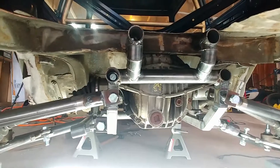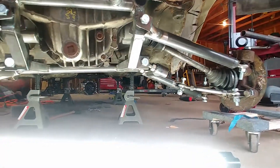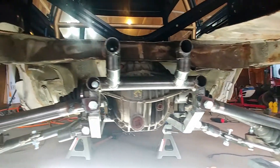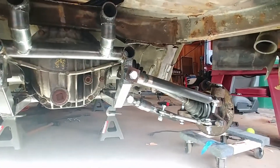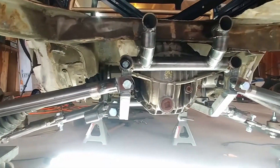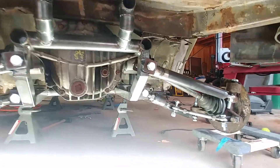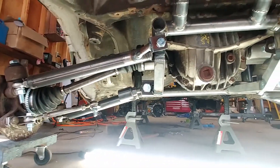I can actually get almost everything up above the factory frame rails — it's very close, maybe an inch lower than the actual frame rails of the car. I believe the undercarriage stampings of the TE72 are exactly the same as the AE86 — I could be mistaken, so let me know if I am. They both came out with solid axle rears, which can be a weak point when you start pushing power. Mine didn't even come with any axles or suspension, so this seemed like the most logical way to overbuild it so nothing breaks.